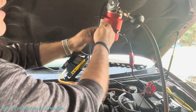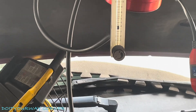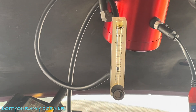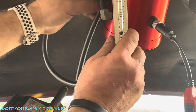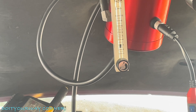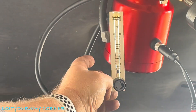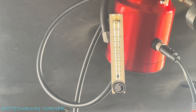So what I'm going to do is connect up to the car now and pressurize the system. I'm going to watch this flow gauge for a second, and if everything's sealed, this thing should actually start to come down to zero. We're going to speed up the film because this can take a little while to fill up the tank and fill up the vent. Okay, so we're at the bottom of the gauge — we're pretty much pressurized.